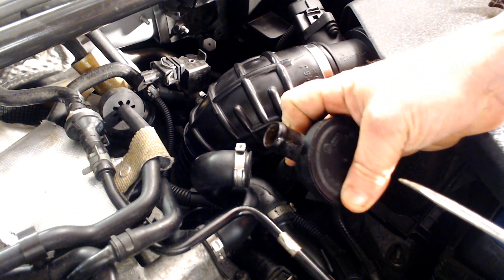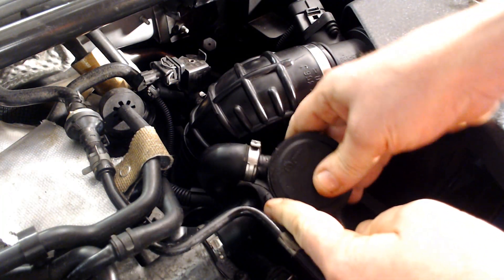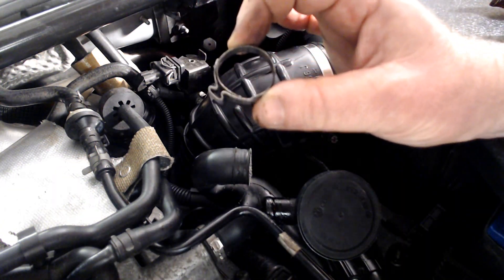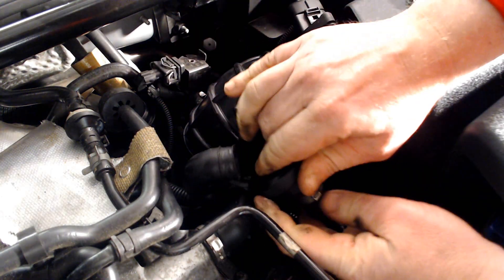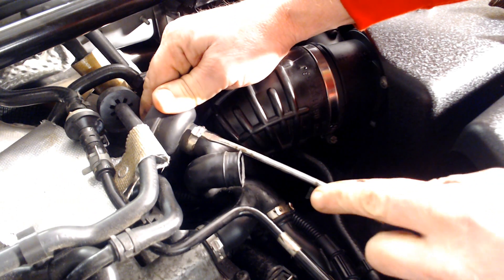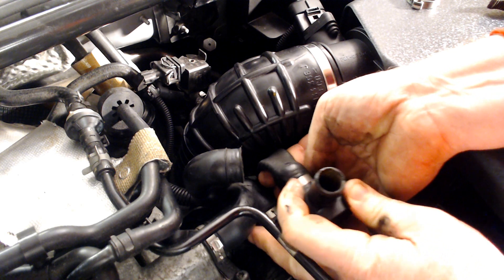It should loosen the pipe enough so that you can wriggle the pipe off the puck connection. My crank case pipe was quite loose already and I reckon I could have just pulled the pipe off without loosening, but best not to take any chances of breakage. Remove the old Jubilee clip from the crank case pipe as we will not be reusing that. With the crank case pipe off you can now inspect the pipe work for splits or cracks as well as the gunk build up inside the pipe — this one all looks good. Pull the puck upwards in the engine bay to expose the pipe that goes off to the turbo intake pipe or tip to access the Jubilee clip. As I do, I can feel the structural integrity of the pipe is failing — it feels like I can mould the pipe in my fingers, so age and the oil vapour over the years has deteriorated it. I will replace that pipe in another video.